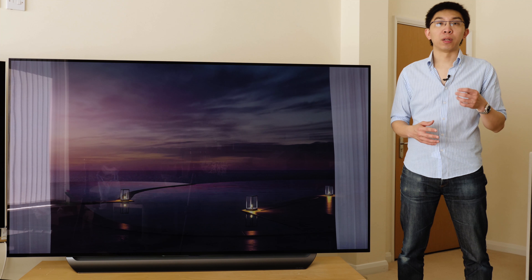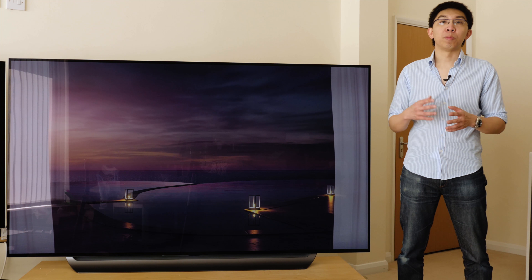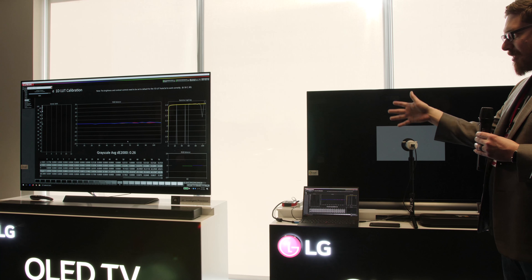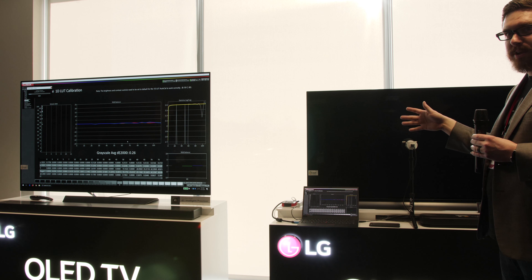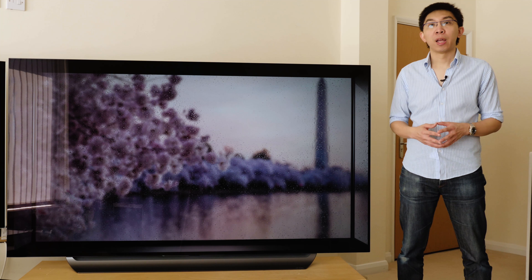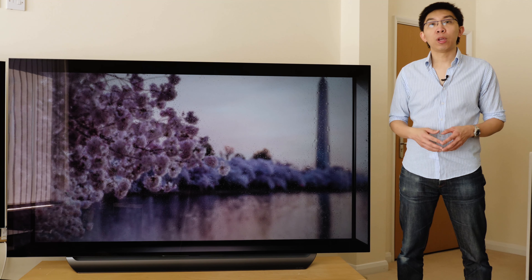When I professionally calibrate a TV for a customer, I always copy down the calibrated settings at the end of the session and send them to the TV owner afterwards, so that he or she can punch in the calibrated settings without having to call me out again in case the TV needs to be factory reset. This is simply not possible using the 3D LUT auto-cal on the LG 2018 OLEDs. Also, based on numerous tests, for the 3D LUT results to surpass the accuracy of my manual calibration, at least 1000 points need to be measured, which would take hours just for one picture mode. So if calibrating for day, night, game, HDR and Dolby Vision modes, I'd probably have to camp in your house all week.